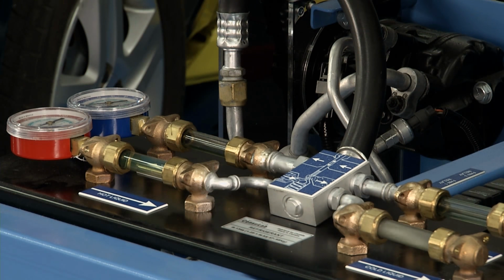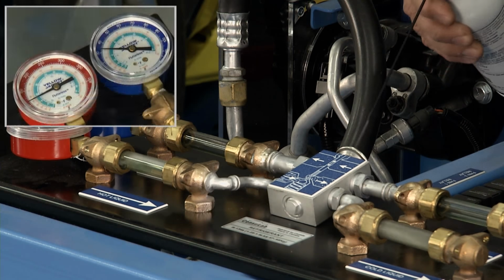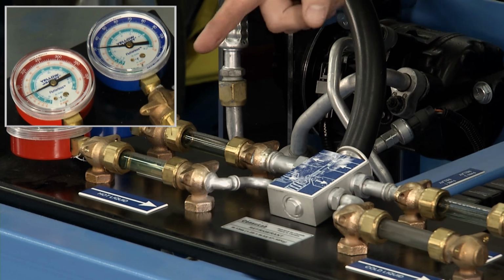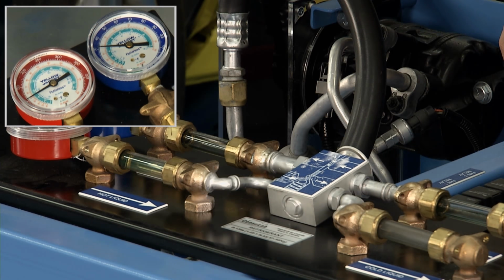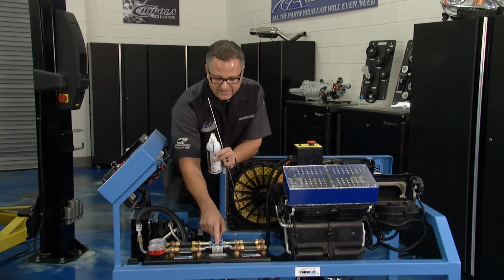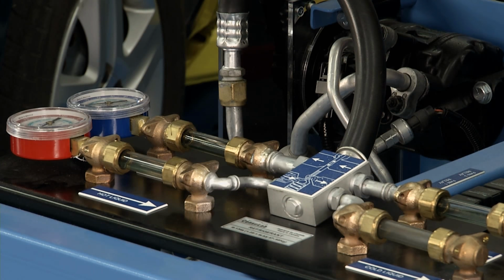We sprayed our Impala, nothing. Check this out. There goes the gauge dropping, and voila. Refrigerant flow stops. Exactly what we want to see in a proper operating system. What happened? Thermostatic expansion valve slam closed.